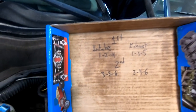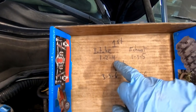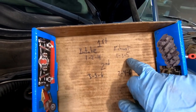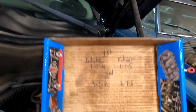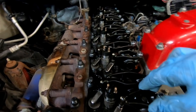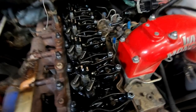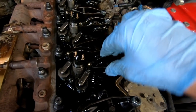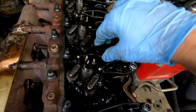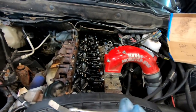With the engine in this orientation we can adjust intake valves on cylinders one, two, and four, and exhaust valves on one, three, and five. So cylinder one's intake side — you can hear it rattle, meaning there's no tension on it, which is what we want at TDC. Then exhaust on number one, intake on number two — but the exhaust on number two should have tension so you can't hear it. That's how you verify you're in top dead center on the first orientation.